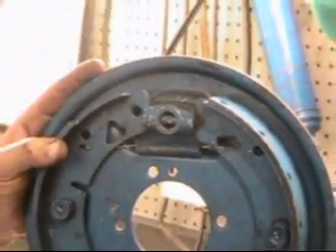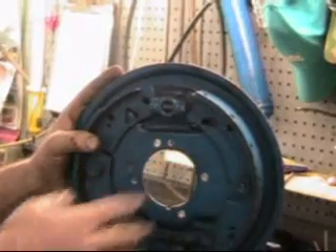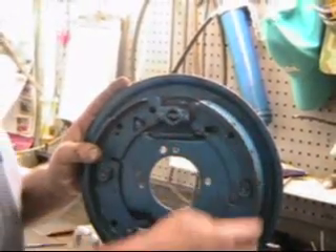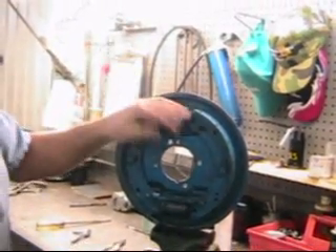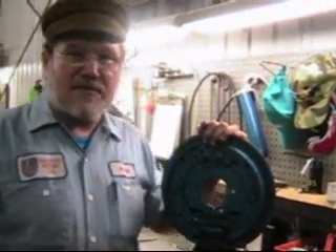If you leave it a little snug, expect it to get a little warm. And after you've put on new shoes and replacement drums or had your drums turned, expect that after about 100 miles you're going to have to adjust them again, because the brakes have now conformed to the radius of the drum and you'll have to readjust. So these are the rear brakes - the cylinder, the shoes, the springs, the adjuster. I hope I've covered everything. Give me an email, tell me what you want to see, we'll put it up. Thanks a lot, see you later.